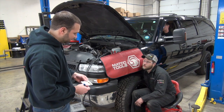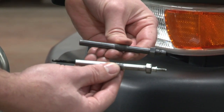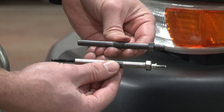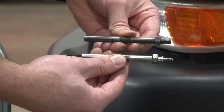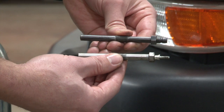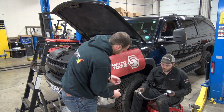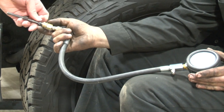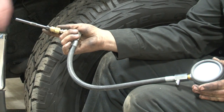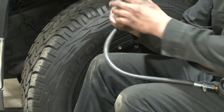Why don't you show us that little apparatus you're using so we can get a better picture of things. On the bottom I have a glow plug that was removed, and on the top I have our probe for a compression test. That's just a straight-through glow plug without a tip, and then that hooks up to the adapter here, all the way to the gauge so you can see what it reads. Pretty simple, but effective.